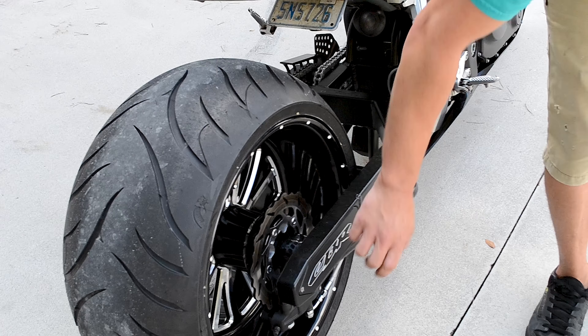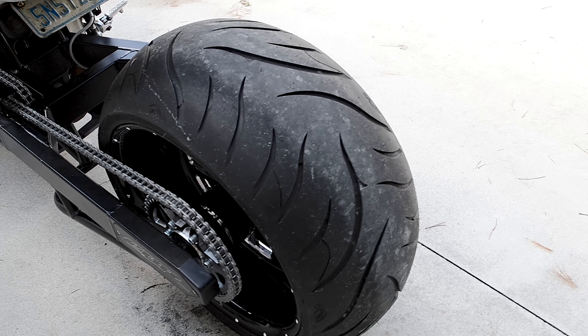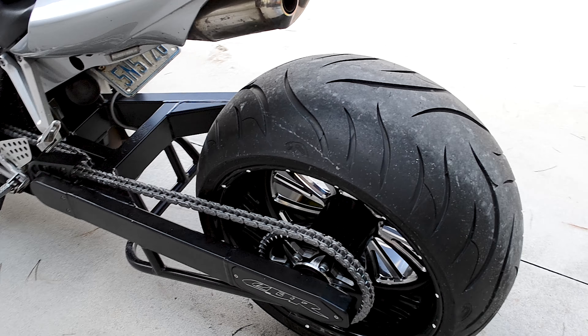Scrolling on back here, CNS hooked us up with our 300 wide tire kit. We did one of our radial braking setups, so that way we get rid of the great big bulky rotor and go with a little bit smaller rotor.